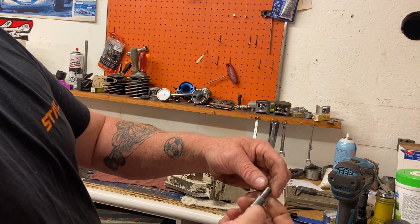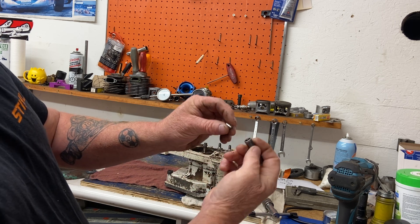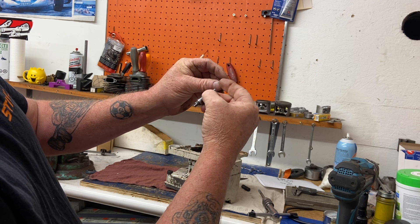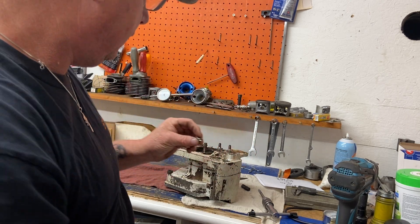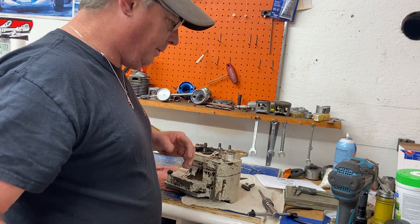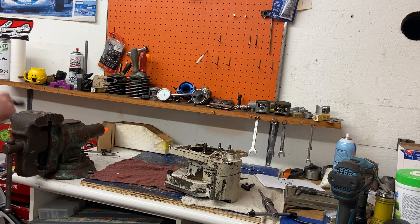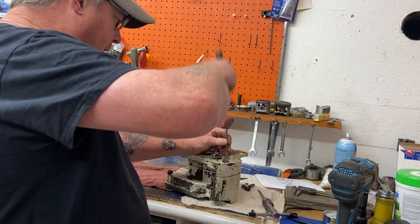There's also this other tool — TWM5, no other part number. This goes in the center, then you pound it with your hammer, and it pushes those pegs down and into the side of the crankcase where your tapped threads are, and holds it in. I've never had one of these ever come out — they've been amazing. I've done thousands of re-threadings like this. Now I'm going to tap it down. You don't need that tool — you can use one of your allen wrenches on your bench. Take yourself a little hammer, get it nice and square, and just give it a pound down like that. Done.